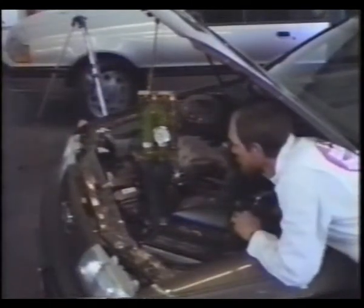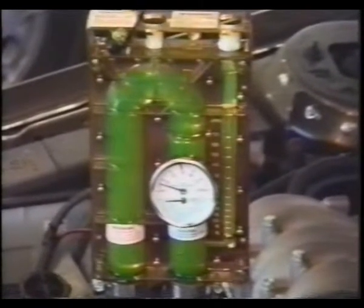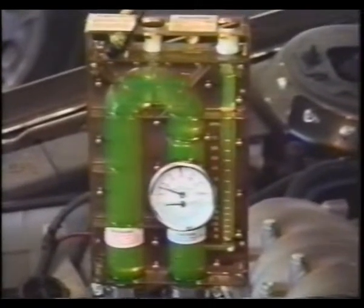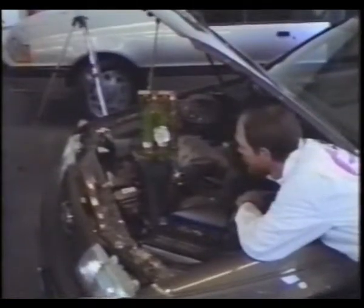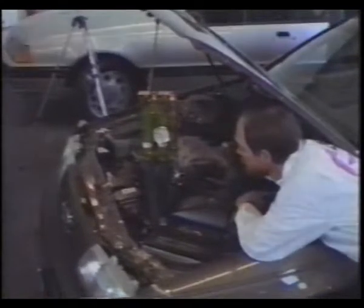Step 6. Start the engine and set the throttle at a fast idle to bring the engine to operating temperature. Observe the condition of the coolant as it flows through the analyzer throughout the test. If testing a very dirty system, the flow meter ball may get stuck in the flow chamber. This requires the removal of the analyzer. See Step 7 at end of test number 8.